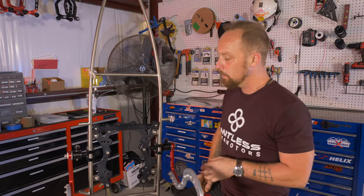You would have to be like this. This is your propeller right here, let's say. And your brake line would have to be about probably 12 inches too loose to even come close to that propeller. So if your paramotor is like that in relation to your wing, something has gone horribly wrong. Lines in the props, probably the least of your worries. You're probably off power at this point, I would hope. That is some horrible drawing.